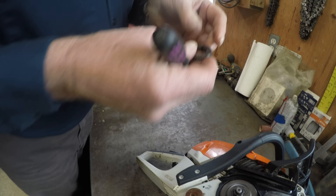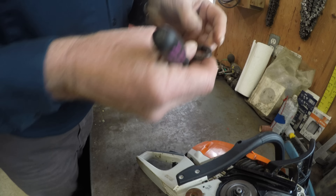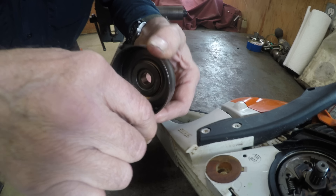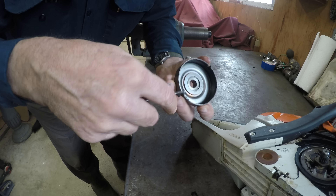Remember, going into those slots there to pull it out — it's spring steel. And this is the one we look for wear. You can see there's quite a bit of wear there. It wouldn't hurt to pick up a couple of these, because as this wears down it's hurting your chain too — the chains are wearing out and this is wearing out as well. So this is sacrificial.